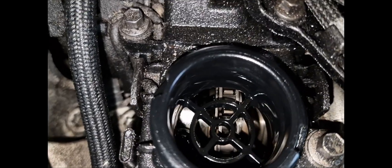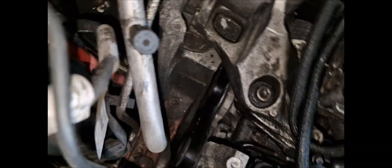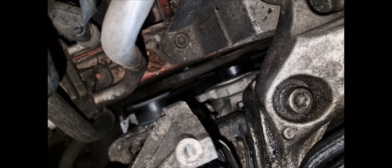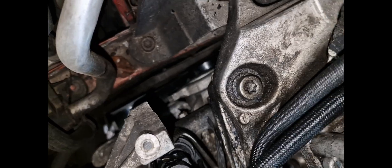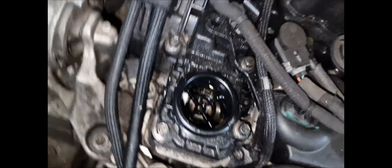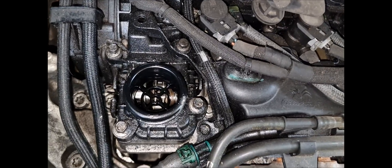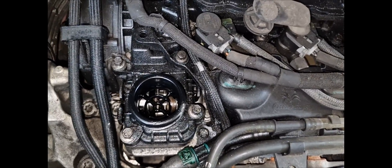Not even one little budge. Looking down here to see if the alternator belt is turning — that means the crankshaft is turning on the starter motor, but it's not turning anything up at the top. Unfortunately, this is a timing chain failed engine.